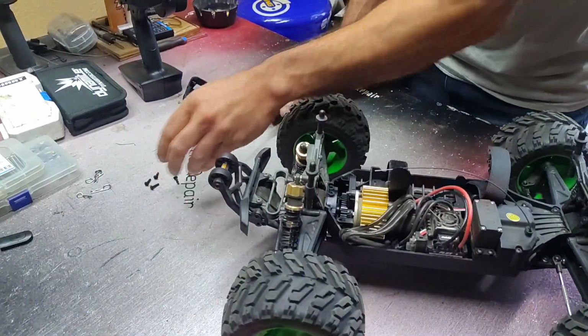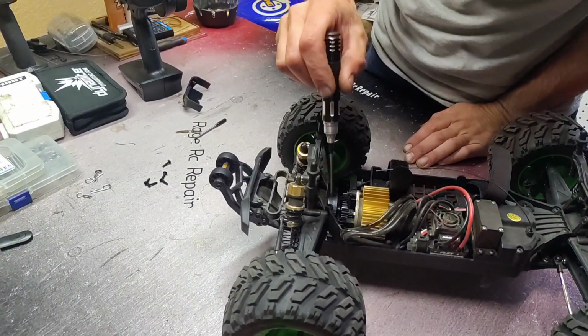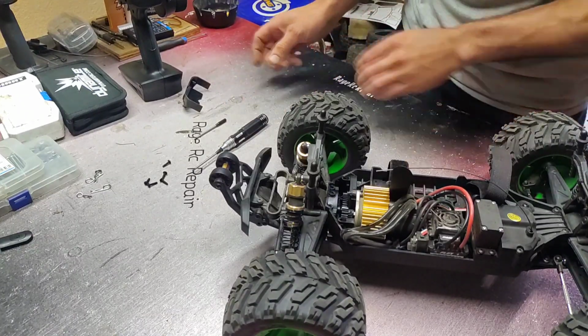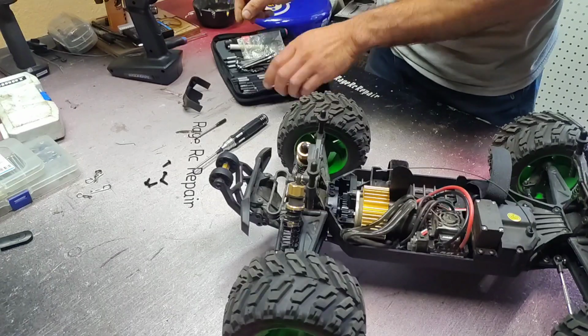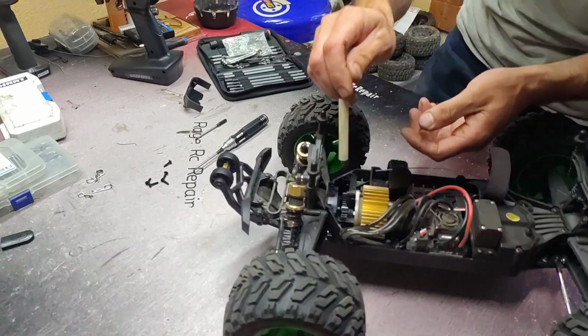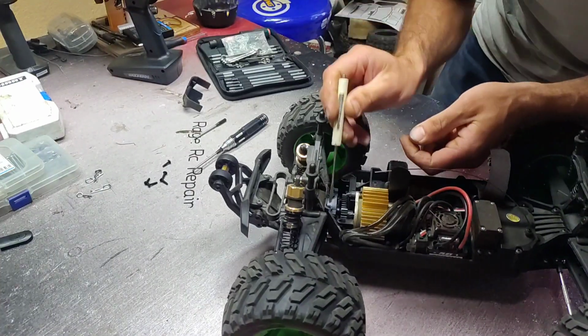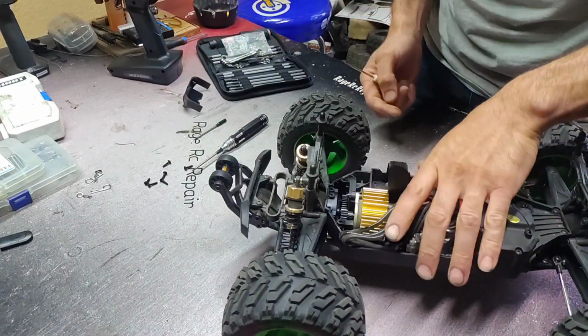All of these screws on the top, the cover screws and the chassis screws that I just took out, the 2 uppers and the 2 lowers are all the same length, so they are interchangeable. You don't have to worry about where you place the top screws. So total, you're going to have 7 screws. And that one there is going to be a bear to get out. So what we'll do is we'll just get it loose.